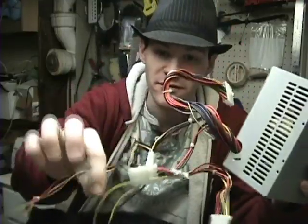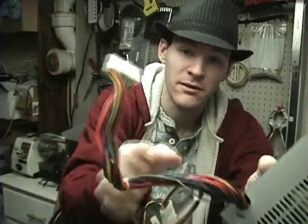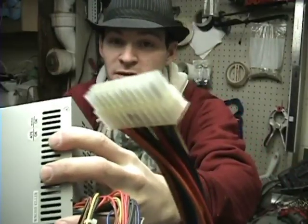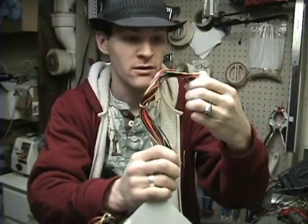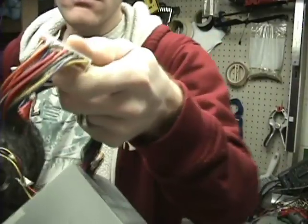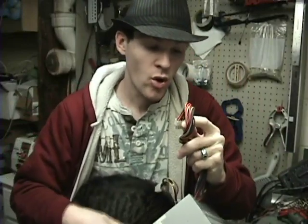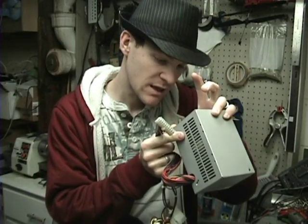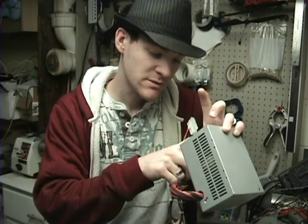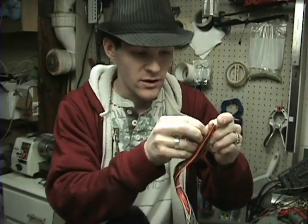On this power supply there are outputs for your hard drives, floppy, CD-ROM drives, and then you have this main power plug. This main power plug — this one says P1, and most of them normally do say P1. On here there are pin numbers, and pin number 14 is written on the back side. Most of the time it's either going to be purple or it's going to be green. I have two different power supplies here — one is purple and one is green. So pin 14 is what you want. This one tells you what purple is: purple is a 5 volt 2 amp supply, so that's not it — it's going to be a signal wire. This one doesn't tell you, but it's a green wire, so this green wire is pin 14.